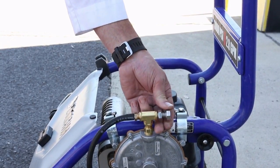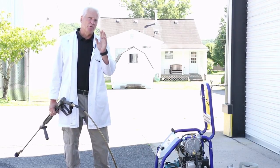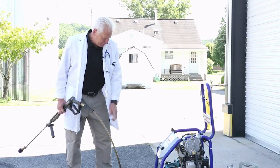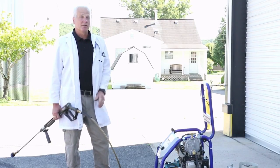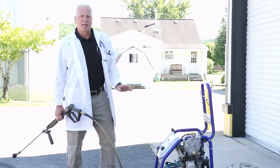They got the 3450. Kept leaning it out, got the 3440. Backed it up just a bit to 50, locked it in, and it was tacking at 3480. So you seen how far out it was. It didn't need to be that way. We want it lean and clean.